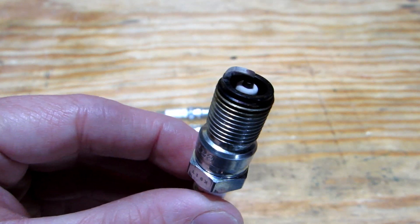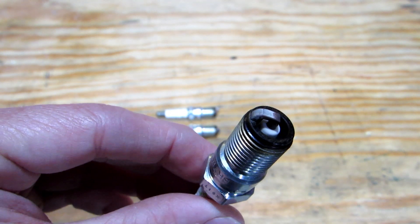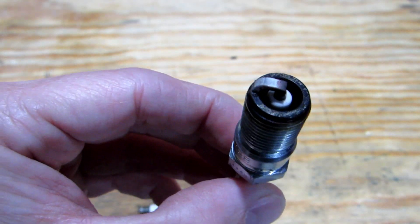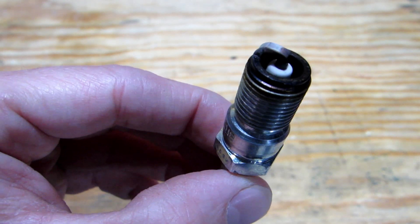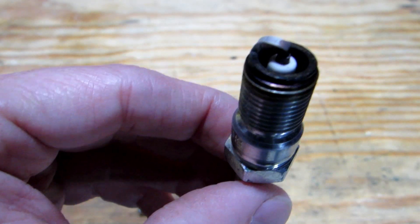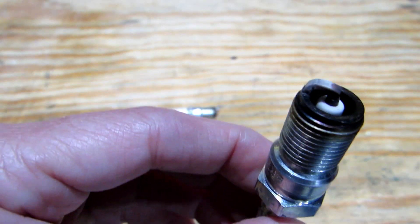One thing that would be bad is to have little tiny black specks on that white porcelain. I like to use a flashlight and look really close under a bright light to see if there are any black specks. If there are, that's the beginning signs of detonation — you definitely want to watch that. If you've got black specks, figure out why: whether you're lean, too much timing, or a combination of both. Even worse, if you shine a flashlight and see tiny little shiny particles, that's part of your piston or ring being melted, essentially.